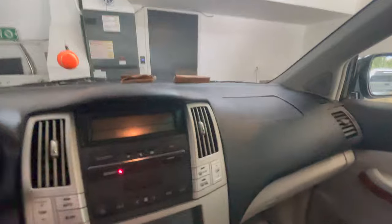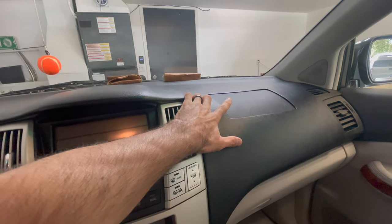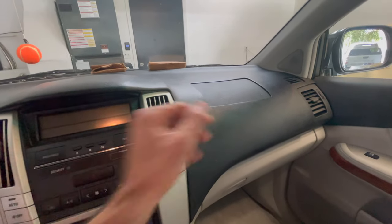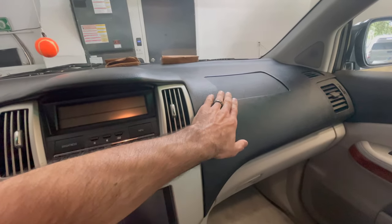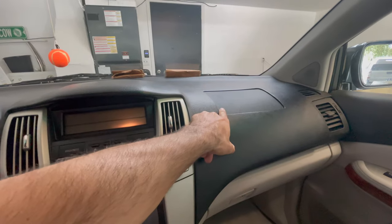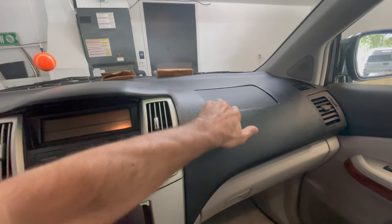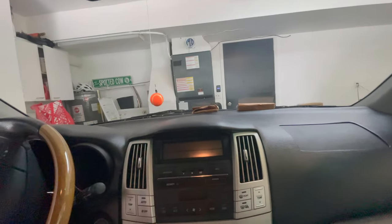My major concern with all of this is the airbag. I bought the one that came with the plastic cover that you can glue on top. Knowing how fast an airbag deploys, there's no way I'm going to be mounting a big hunk of plastic on here — some of the made-in-USA covers don't come with that. In hindsight I would go back and buy the USA one without the cover. My biggest concern is whether the opening for the airbag is correctly aligned — what if this whole dash comes flying off with the airbag? That makes this whole process not worth it, not knowing.